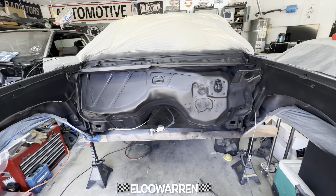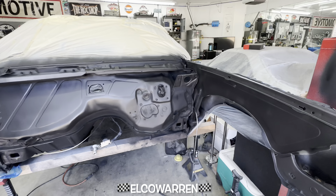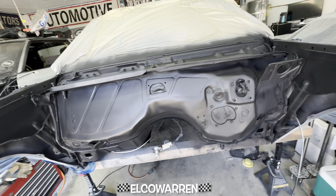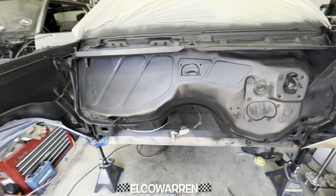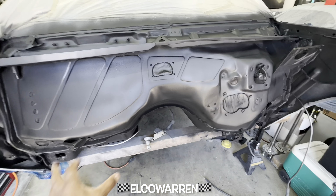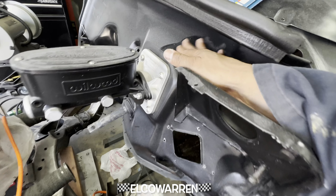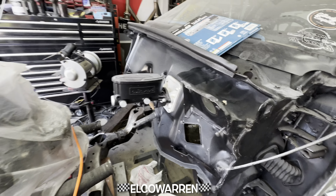I'm really digging the way this is turning out. No filter — these panels are flat. Trust me, they are flat as hell. That block sanding — it's been me trying to figure out what to look for, and now I saw it. The guide coat tells you everything: those little bitty areas mean it's lower. I wasn't worried about burning through because I had multiple coats of the 2K high build from U-Pol on there.